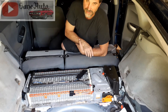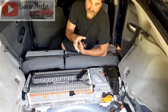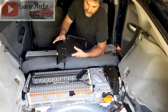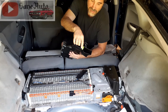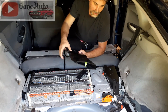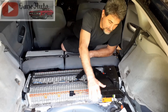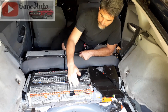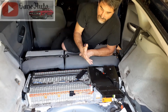If you do have to replace the fan, do all the cleaning you can while you're in there. As bonus material: besides adding extra filtration for the fan, I like to put something — I used a bottle cap — and glue it in place to keep this duct opening open, because these ducts do collapse. Luggage and heavy items compress everything and end up mashing the duct closed. If air can't get out, air can't get in, and you need that airflow for cooling.